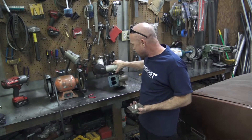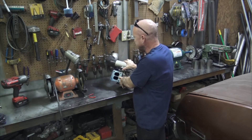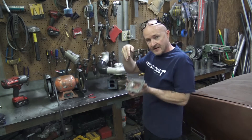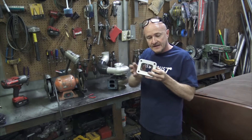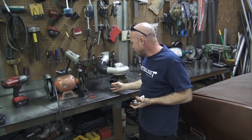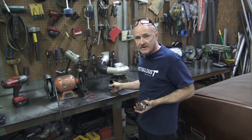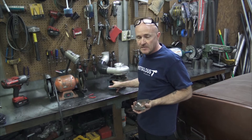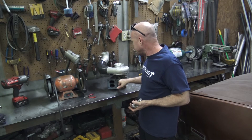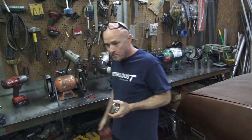I've already sprayed this down with a little markup dye and I'm just going to take the calipers and make a line in the center here, then take out the die grinder and work this thing to a nice feather edge. When the air goes in to this side and hits the turbo, it'll split out to the other sides. I don't know that the twin-scroll design is really all that helpful on a big V8 where the pipes are all coming to one port anyway. So I'm going to take the housing off, scribe it, and take the die grinder to it.